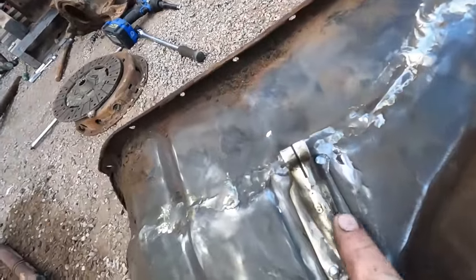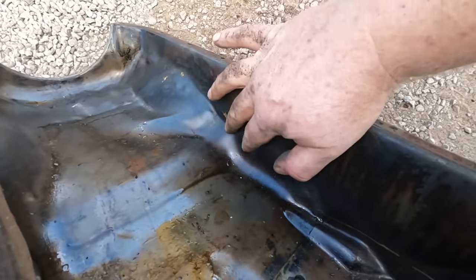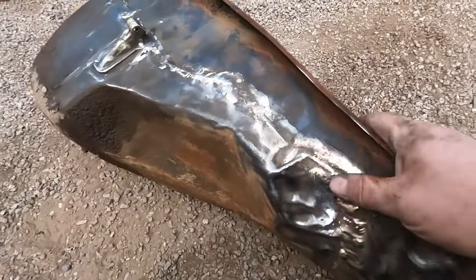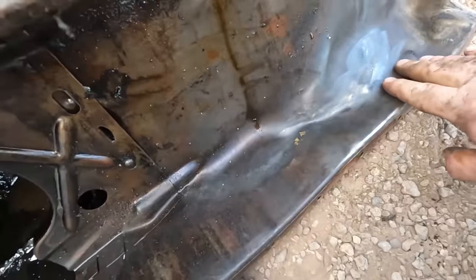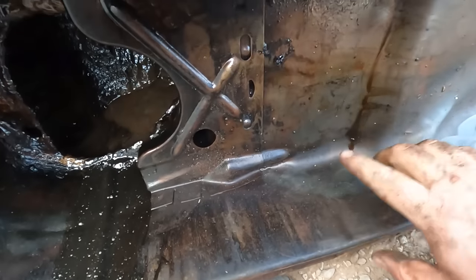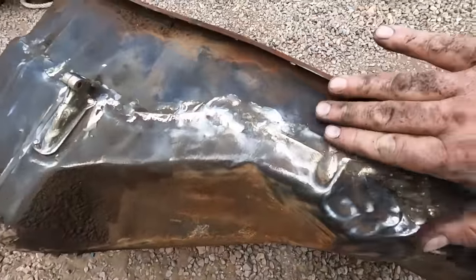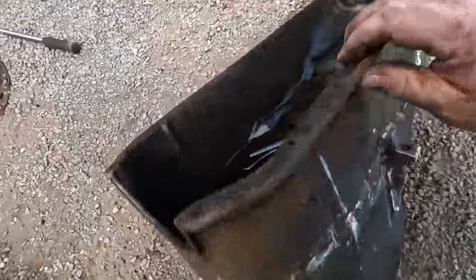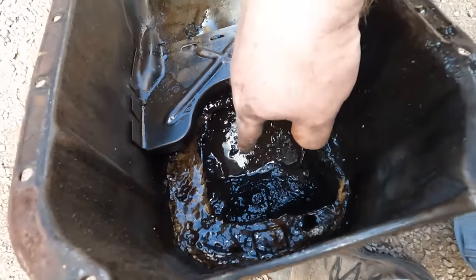And looks like a little cast brass piece that was riveted in. Now the inside here is nice and smooth. Now when I saw this, I expected to find a seam like this on the inside, but that's not a seam. This is the original oil pan. Look at the height there. That bottom of the pan is still there. They added another sump on the bottom. They just cut a hole through it. That's why I had trouble getting this off the oil pickup.